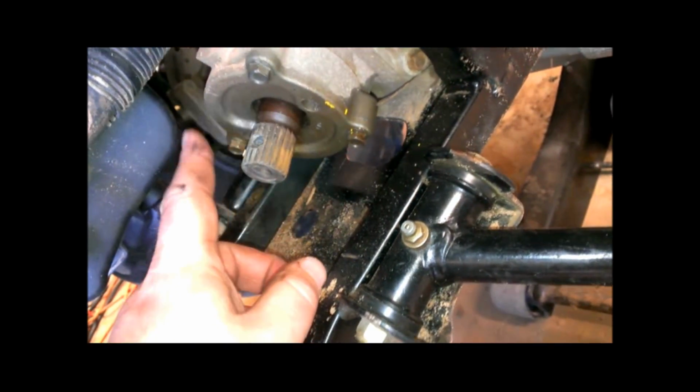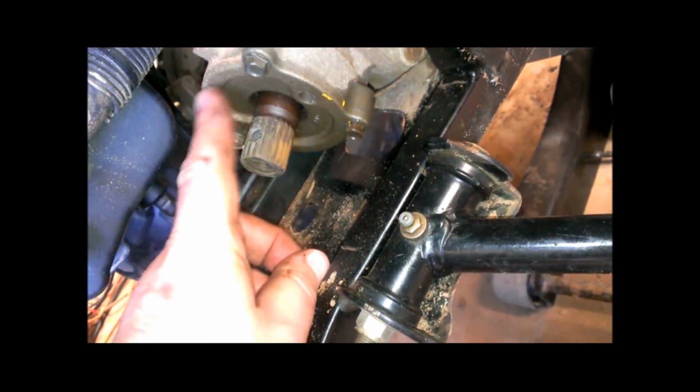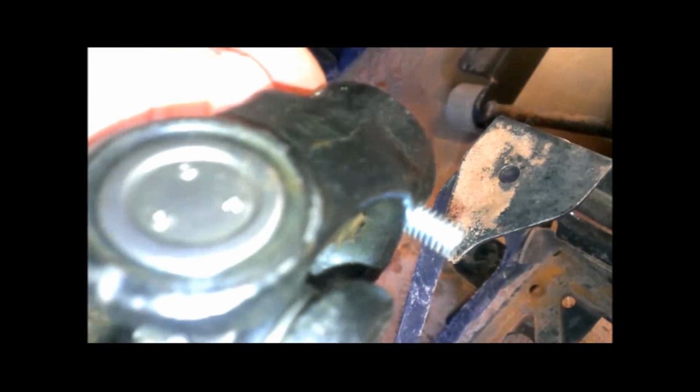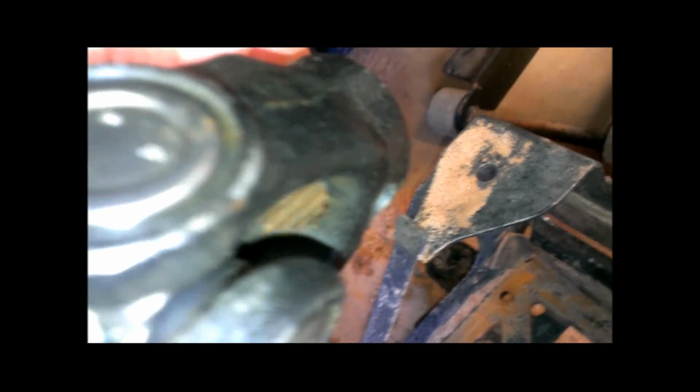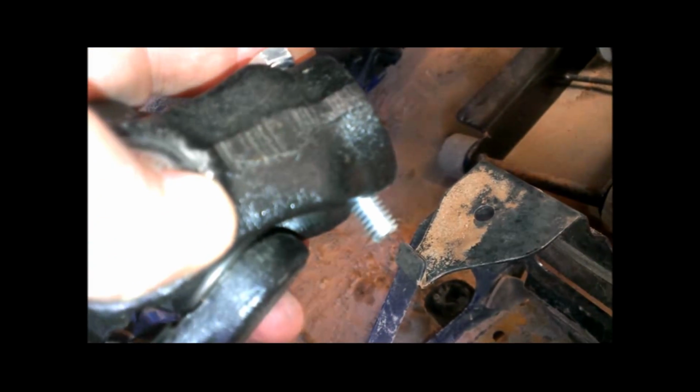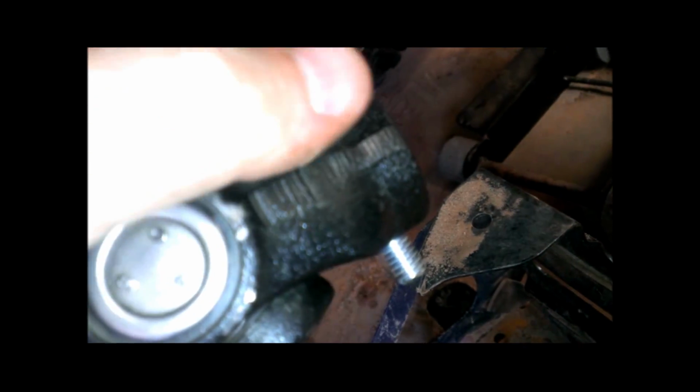So I pick up this bolt, and it's a little long, so I'll take it over to the bench grinder. You want to make sure that if anything's sticking out, you've got space around here so it's not hitting anything, especially if you're near your transmission. You don't want to be making a hole in your transmission, which is not uncommon for the pins to do if you have a rear prop shaft, which this one doesn't.